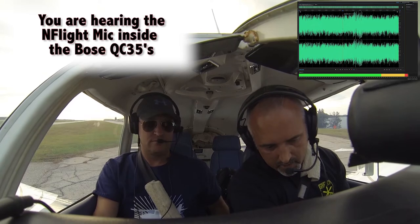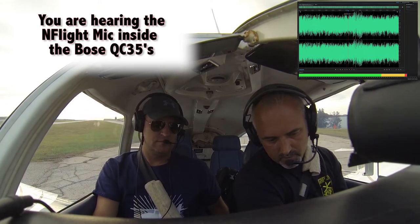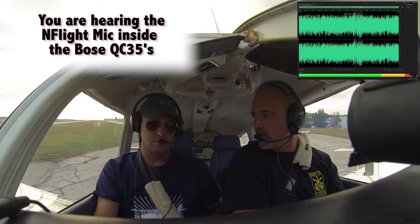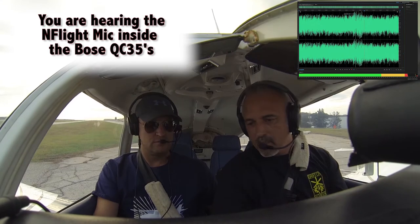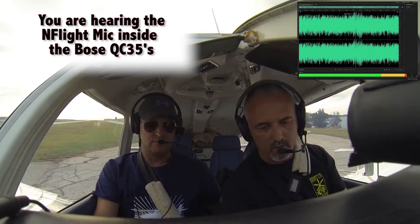All right, we're going to check our mags. So we've got a little bit of a drop — back up. A little bit of a drop — back up. Now I'm going to open this back up. Is it going to make a big change or not? Not a whole lot. We'll close it just for clarity. The suction looks good. The carb heat does work. All of our instruments look good.